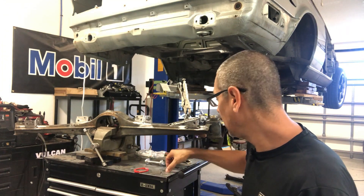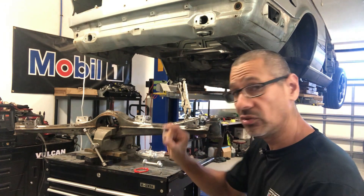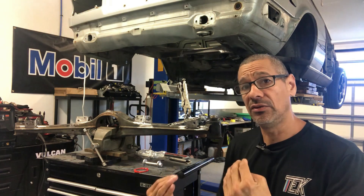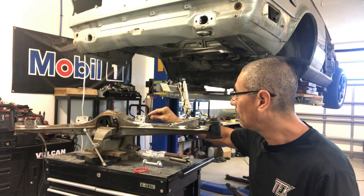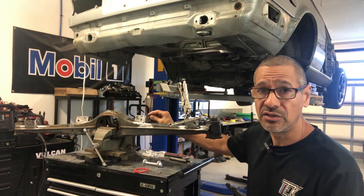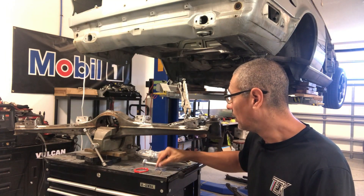What I ended up doing is making sure my rear subframe is all aligned, because you need to get these straight up and down so they're not crooked. There are a couple different ways to go about this — if you go higher on the camber adjuster, that gives you more adjustment range. I'm going to place it in the center so I have the ability to dial in positive and negative camber by roughly equal amounts. That's what I'm going to do.